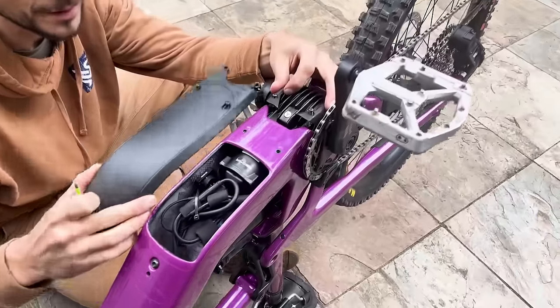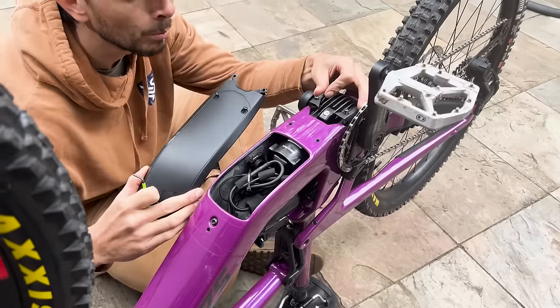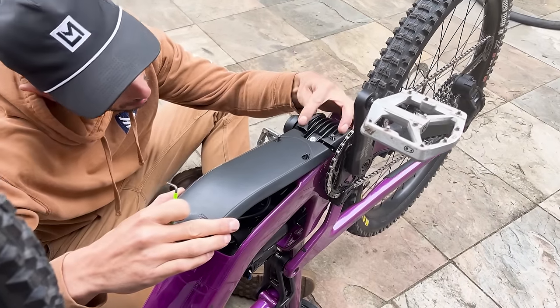You might have been setting up another bike. I noticed it immediately, on a brand new bike pedaling up the road. It sounded horrendous. Under heavy load, it was kind of twisting. I thought the motor was loose on the bike. I was like, what is broken on this bike? Turns out it's just the plastic cap on the bottom of the frame. When you're putting a lot of torque on it, the frame and motor are twisting, and that plastic guard cover is attached to both, so there's enough flex going on there.